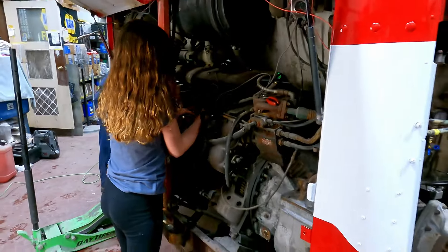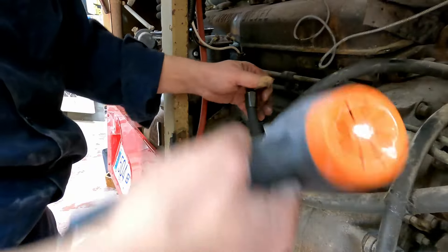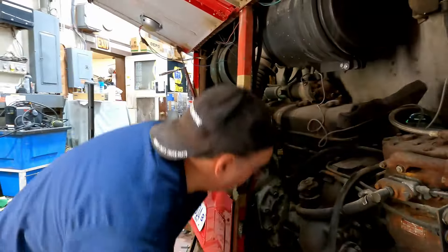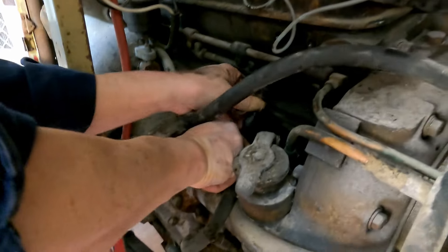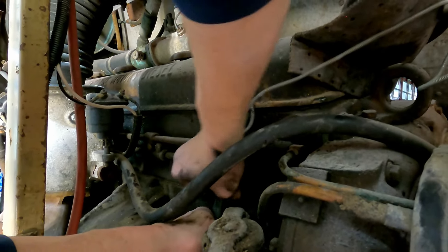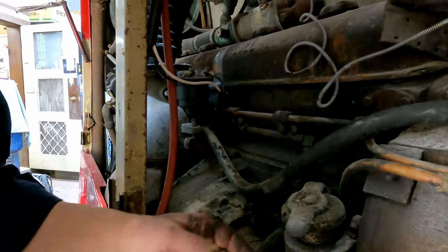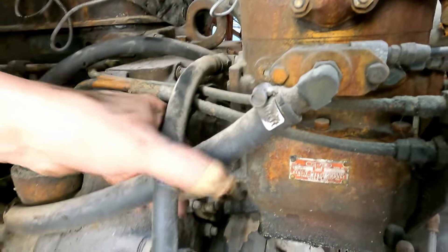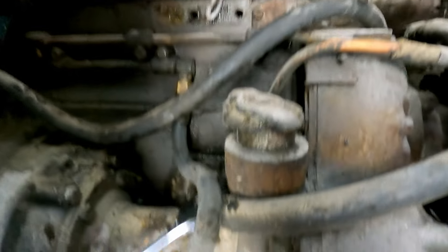Got that out. I'm going to warm it up, see if I can get it to soften. It's already starting to soften — it's not smoking. It's diesel fuel getting a little warm. Let's see if I can get that up, get this on me, bend it like this, just like this, and this goes like this. Wow, that line is hot! I should be wearing gloves. Nice and snug. I turned it away so now it's not touching this one — you don't want hoses to rub. If they're going to rub and you think it can't get past it, you tape them together so they stay tight and don't rub their way through and make a hole. I turned this one on purpose so there's a good quarter-inch space inside here.